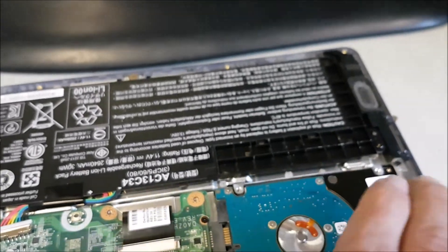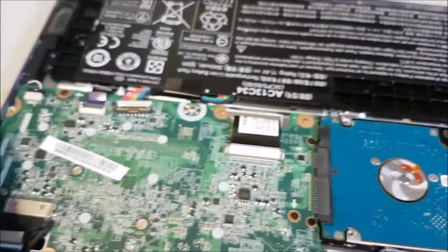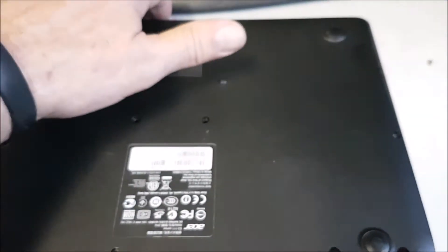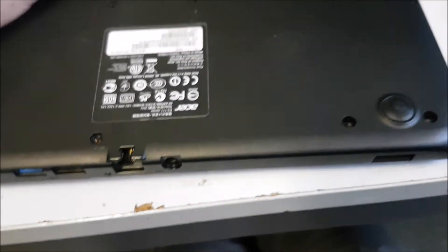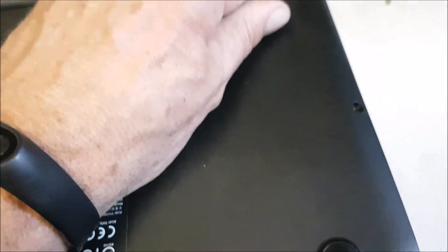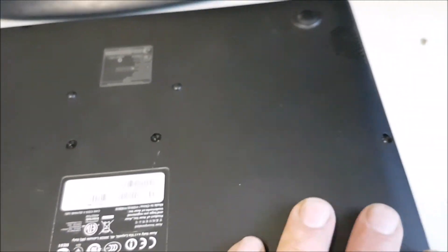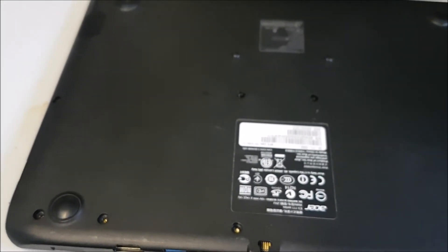New drive. Easy. In. Sorted. Cover — the cover has to slot in at the back first. So you've got to slot in the USBs and the drives first, and then home. It is a very easy fix, once you've ordered the new hard drive of the right size. All the screws are the same, like I said. Put them all back in. Done. Thanks very much for watching.